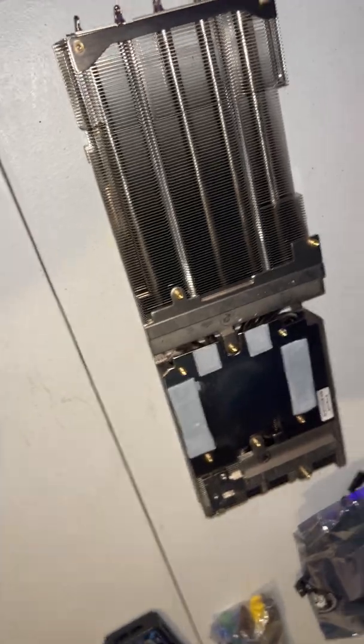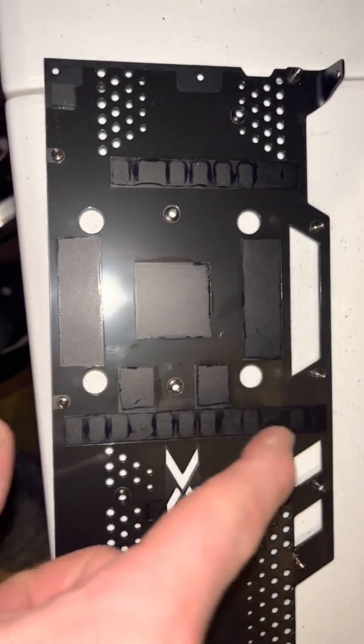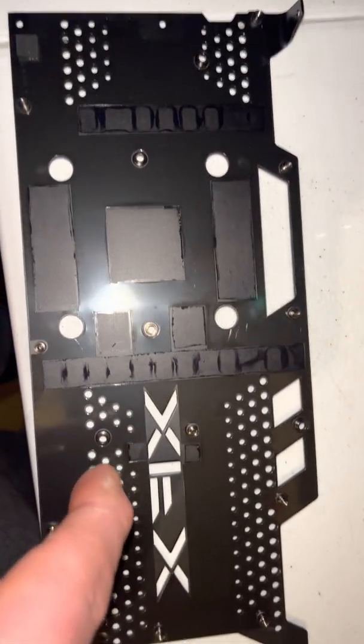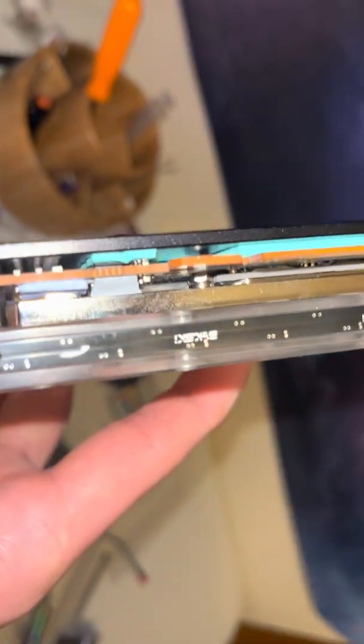On the back plate though, you will notice these. You're going to want a heat gun. If you're taking this card apart, please listen — because the back plate is right here, and you can see the spaces where all of these different things were, all the different thermal pads. These were regular thermal pads here and these are different, and then there are two little odd ones right there for other chips. The big C plate is metal, so yes it'll conduct heat. It's a nice thick piece of metal — it's not cheap. Make sure you put those thermal pads where they belong.